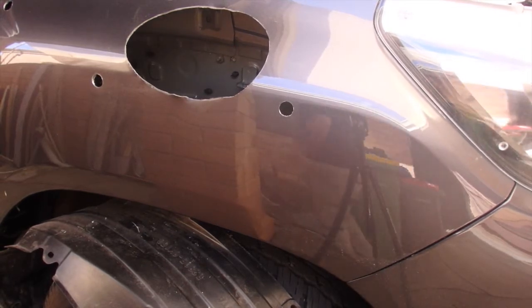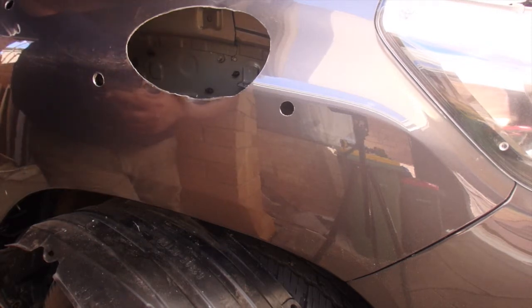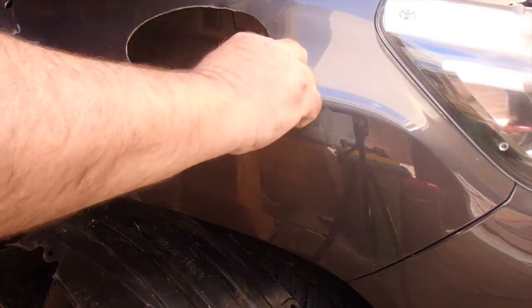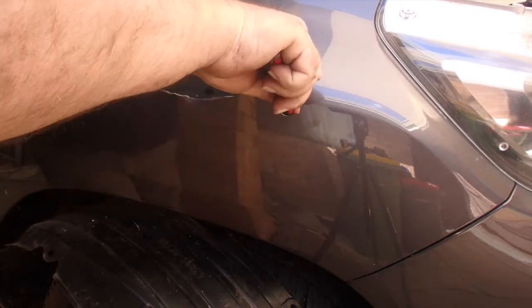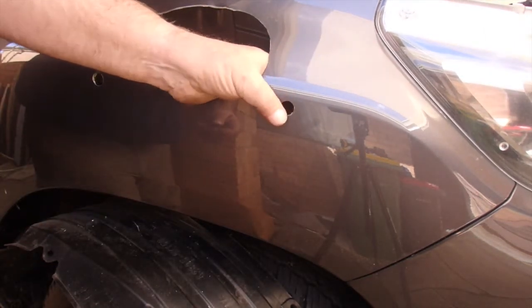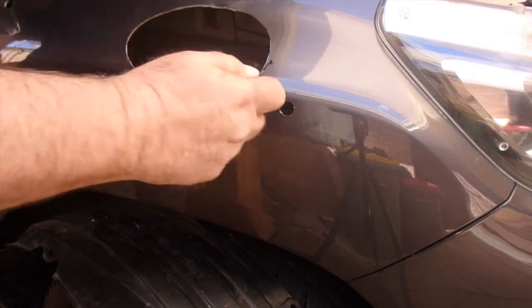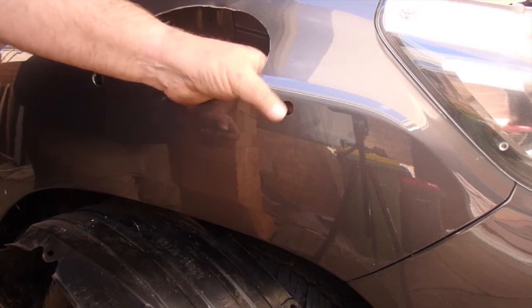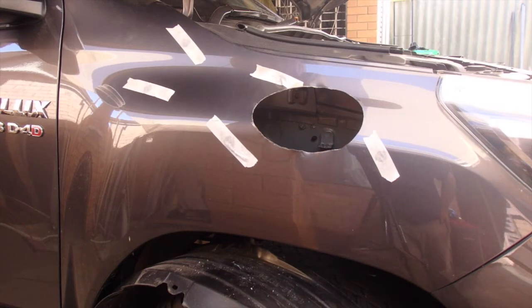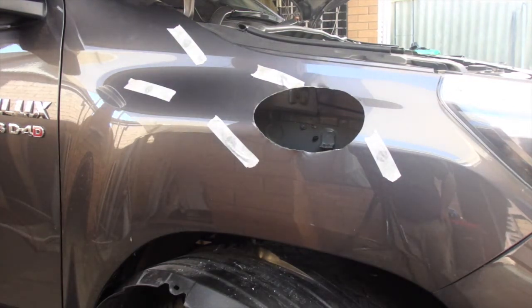A blind guy would be glad to see that hole! So what I'm going to do is deburr these holes, have a test fit, then tape it up and paint it from the back side, then paint it from the front side — the last thing we want is rust starting. This is a deburring tool that takes those nasty daggy bits off so no one gets cut fingers in the future. I've put tape on the outside of the panel, sprayed the inside where I've been drilling, hand-painted the snorkel cutout, and I'll put a layer of lanolin grease in there before final reassembly just to be safe.